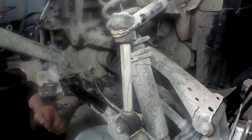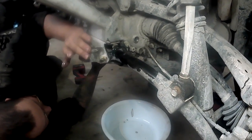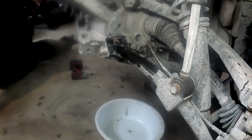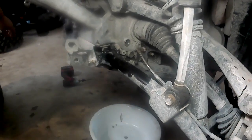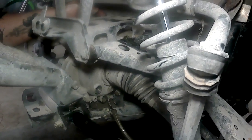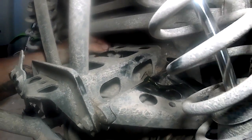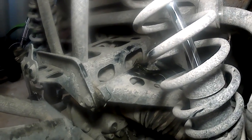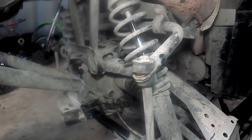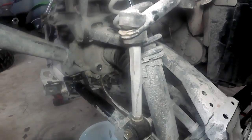That is milky. It went in the pond — that's what it did. Absolutely it did. Where is the breather hose on these? It's right here. So this is the breather hose that goes in the top of the casing. That might get an extension in a video or two — we might have to relocate that to a more upward position, cause I like water. We happen to have a pond here on the compound that we play in quite frequently.